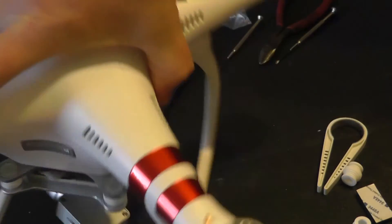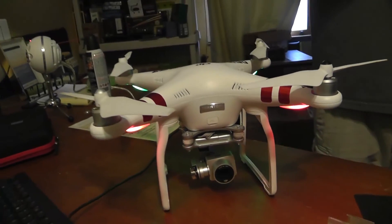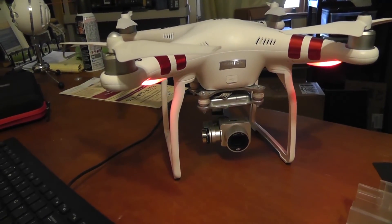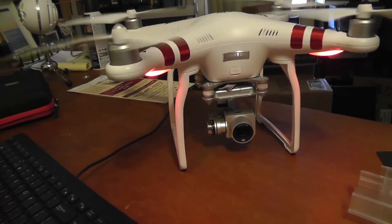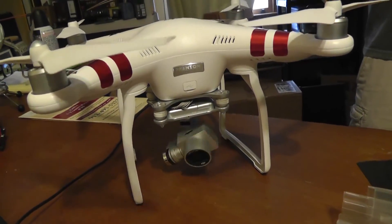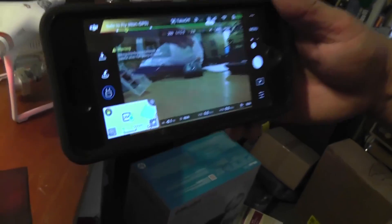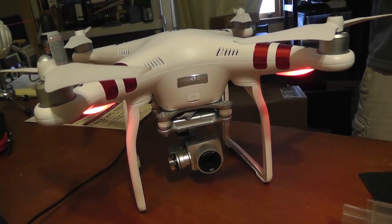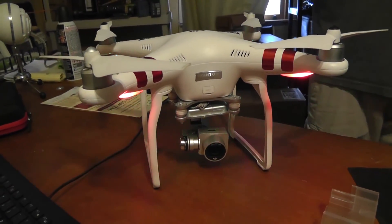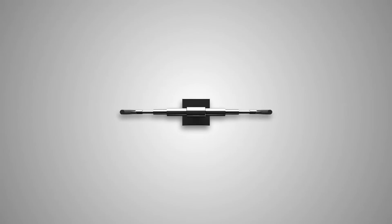Our Phantom 3 gimbal is repaired. All we have to do now is test it. Please be aware that after replacing your gimbal, you will have to go through the pairing calibration once again to pair your controller up with the drone. When you first replace your gimbal, you will get a no signal error on your controller, so pairing the controller to the drone again corrects that problem. Once you pair up your remote to the drone and fire it up, as you can see here things work quite well — we got good video and everything. Got this drone fixed up. Please rate and subscribe to my feed. We got more videos on the way. Until next time everyone, see you soon.